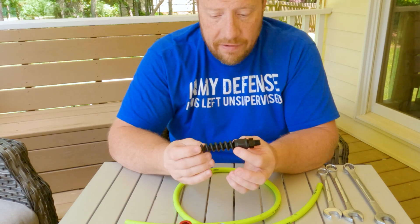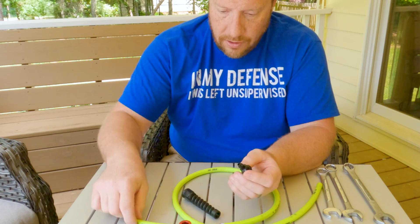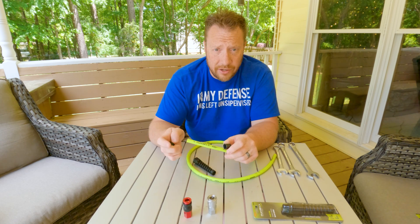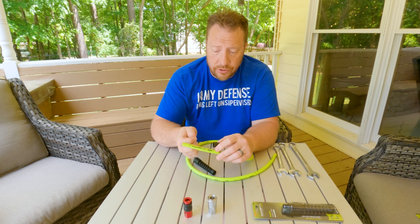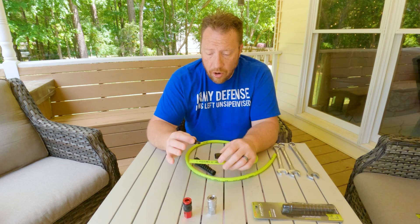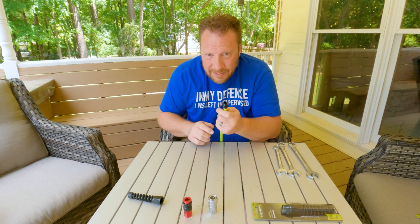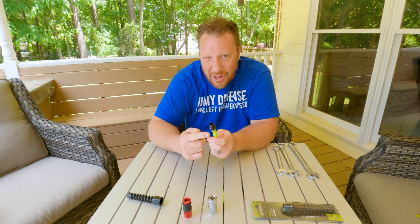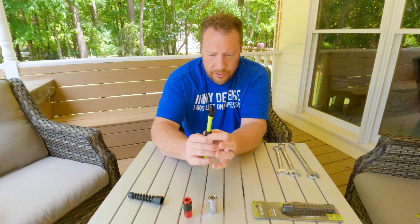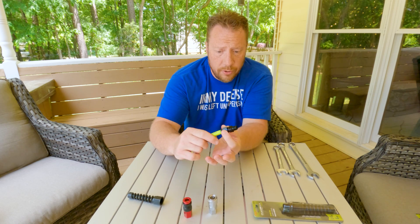Here's how I'm going to set it up. I have a reusable hose fitting for each end of the hose — these are really nice, you just unscrew this, put this part into the hose, and it screws together. It creates a compression fitting that holds the hose tight onto the nipple. The really nice thing about these is if something goes wrong with this hose and you're out on the trail, you can just unscrew it, cut the hose, screw it back together and it works perfect. It makes trail repairs really easy, and I think that's a really important thing.